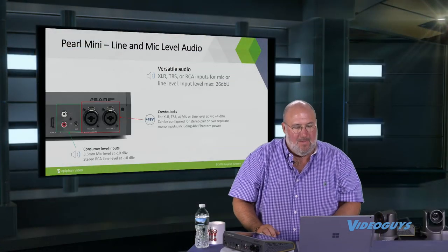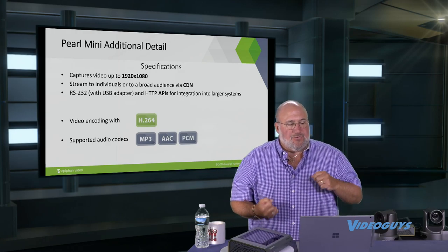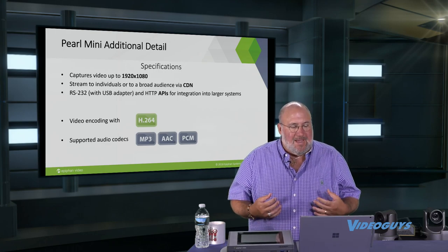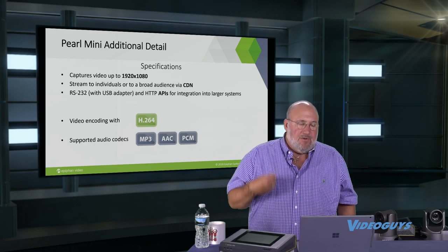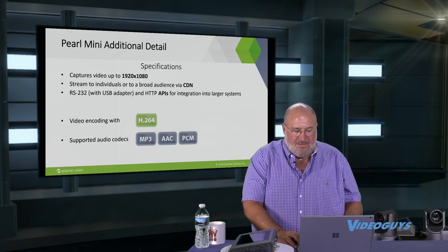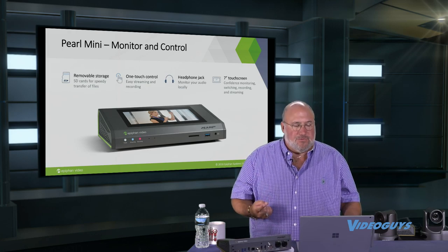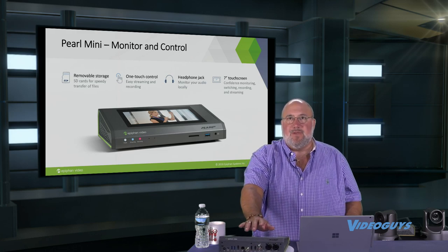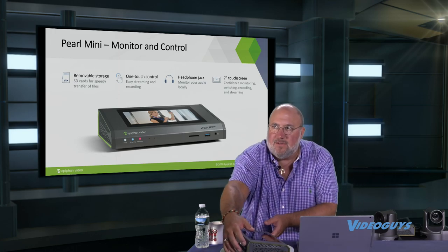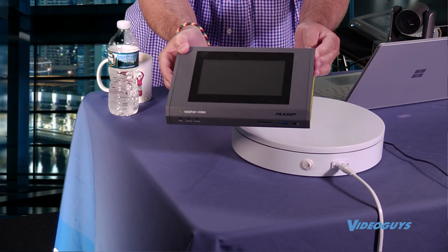Cool. All right. As far as specification, it'll capture up to 1920 by 1080. You can stream to individuals or to your choice of CDN. It uses RS-232 through a USB adapter for protocols to control it. You can encode into H.264. Supported audio codecs are MP3, AAC, and PCM. The Pearl Mini can be used to monitor and control. It takes removable storage cards, with one-touch control from the surface of the Mini itself. It's got a headphone jack and that 7-inch touchscreen. In fact, I want to twist this over to this camera again if we can, so people can see the size of that touchscreen. Now, if we cut back to the full shot,